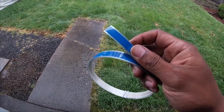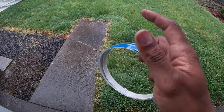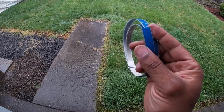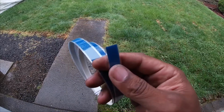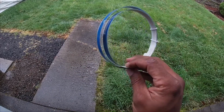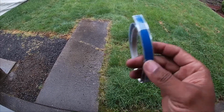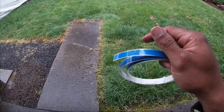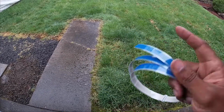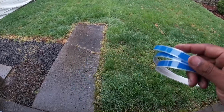There is a way you can actually wire this in. I think you need some copper wiring that is flat, and I think you can hook them up, because I think these EL lights have 2 sides to them. It's kind of like a positive and negative, but you have to open them up and do all that. I tried to open one end of it up, and it was just too hard. These things are like $8 anyway, so I just ordered another one that's already wired in. Then I'm going to take those two, my one that's hooked up right now and the new one, and tie the wires together to the inverter that I bought, and hopefully that'll work. And I'm going to tie those power leads into the interior lights, and that'll power through the inverter and hopefully light these up.